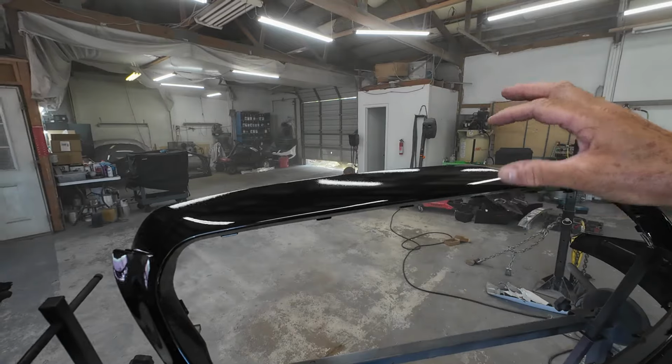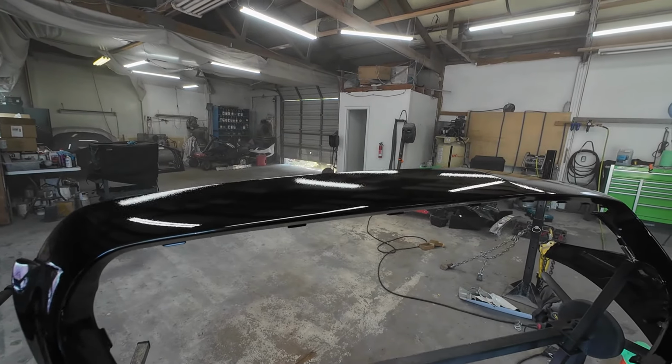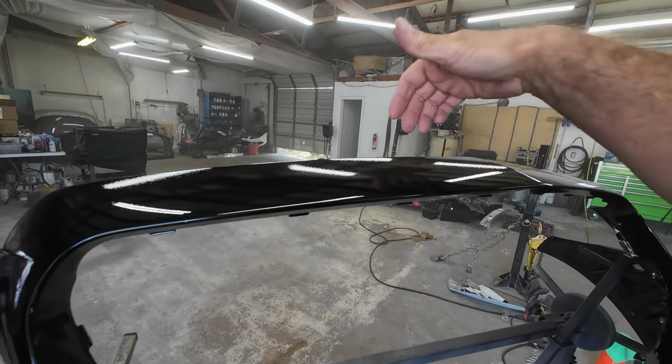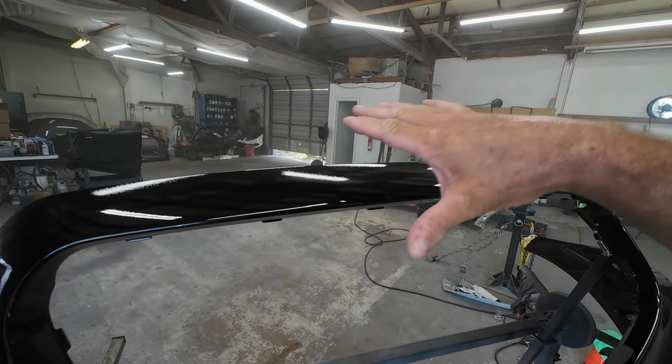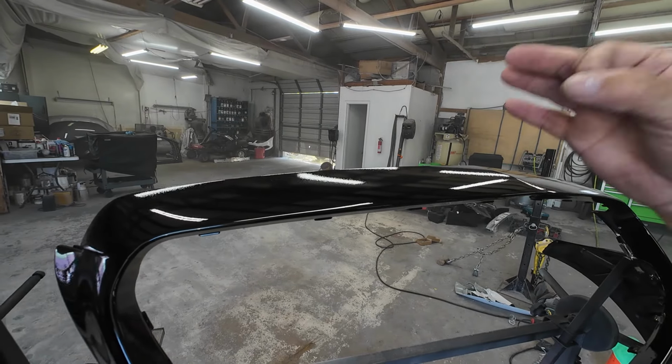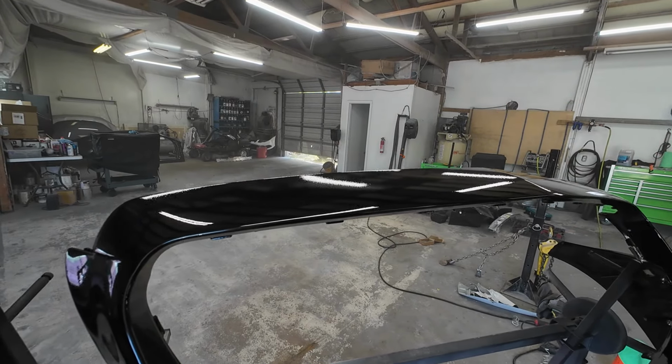This is what I mean about wet edge. So this you had nice and slicked out, right? Yeah. It started to dry. Then you came back and you dusted here. What that does is put overspray over the rest of this and makes it look a little rougher. You don't get that slick finish, so you always want to keep that slick finish.